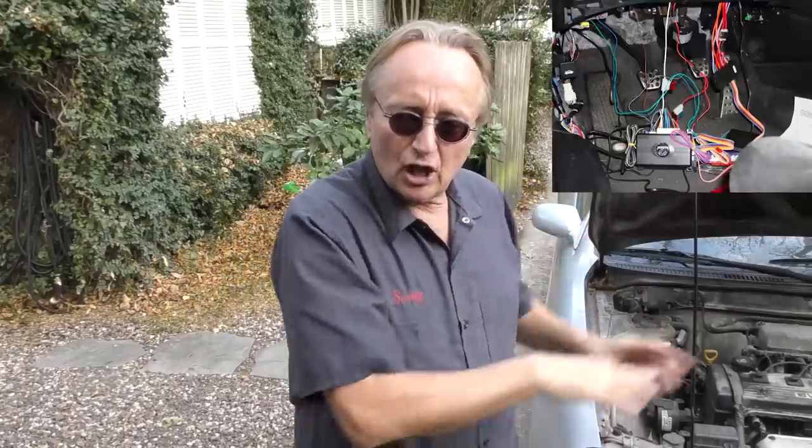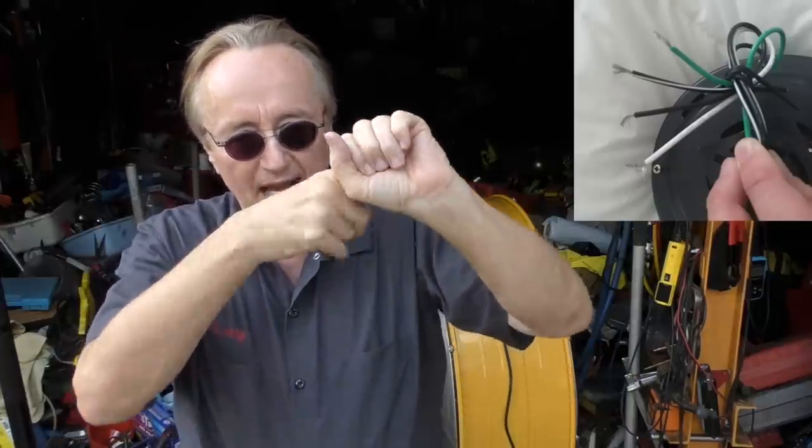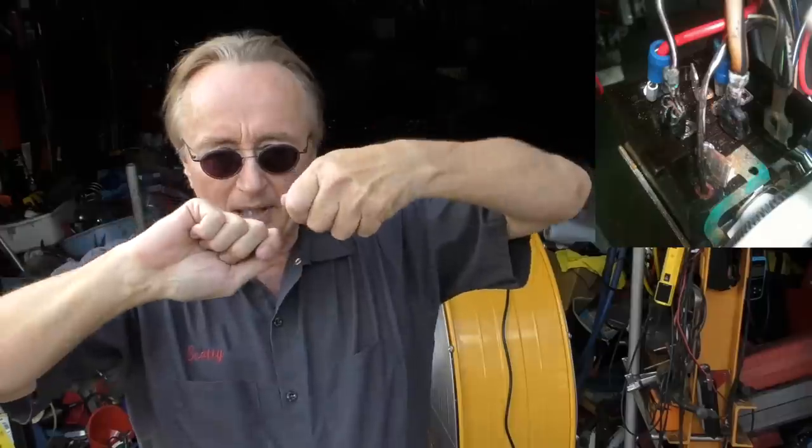And if you do have one of these aftermarket systems hooked up and it breaks, a lot of times you're going to have a hard time finding anybody who will even work on it. I'm an open-minded guy — I help out my customers — and when I get a pain thing like that, I just say, 'Look, this aftermarket system is insanely complicated, I have no idea what they've done to it, you don't have a wiring diagram for it.' I just say, 'Look, I know how your original wiring system is — I can look that up on my AllData — and what I will do is disconnect all the wires they've hooked up and reconnect them all to the factory specifications.' They still make cars logically, with all the wires color-coded. So if you have a black-with-a-white-stripe wire and there's stuff hooked to it, you disconnect all the stuff they added and just splice the black-with-white to the black-with-white again, and that's back to where it started.